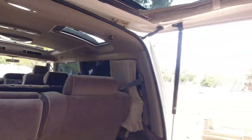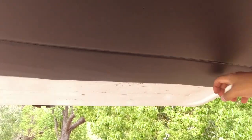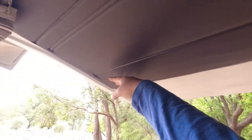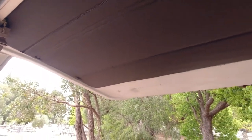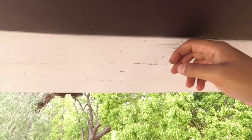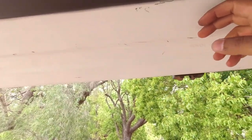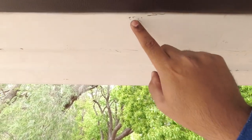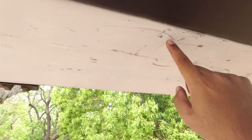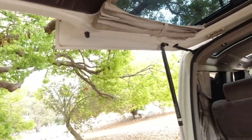And just looking back at the tailgate itself will give you a good idea as to how the car was used. If this is not ripped or torn, which is very common for these to have tears in them, you know that predominantly it was a passenger vehicle, but if you move further down, you'll see that there's quite a bit of wear here, which will indicate to me that this car was used for some sort of commercial work, where heavy sharp items were loaded into the back and have scraped the paint in very distinct sharp marks and dents, which feels in line with the story of this car,